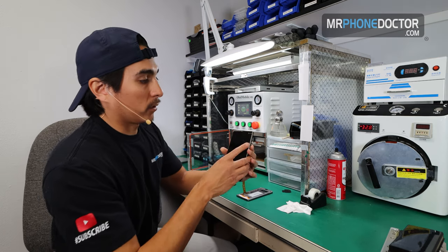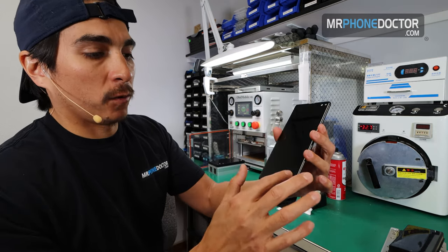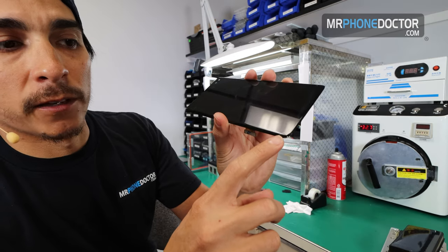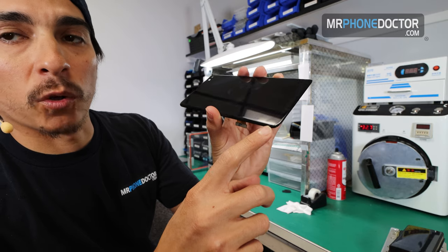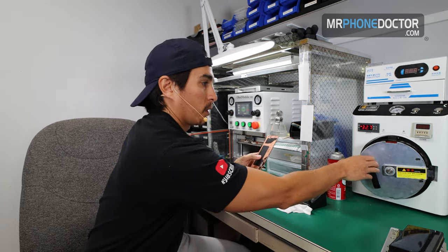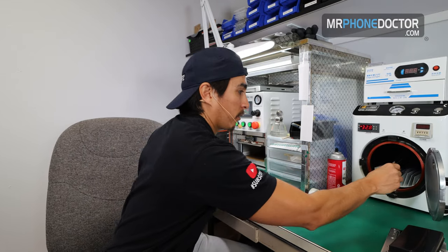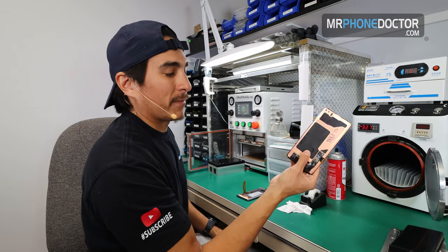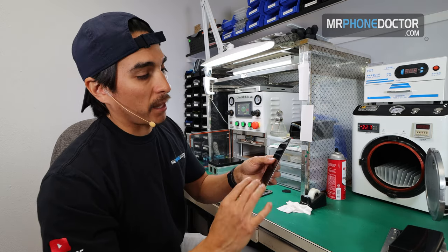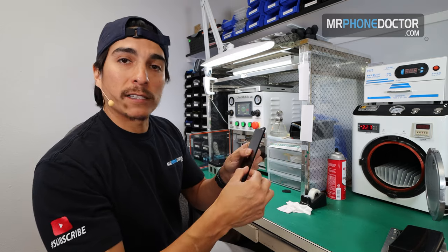So our last final two steps is of course going to be to autoclave. Autoclaving is gonna relieve any of these little minute bubbles that are there. And you can see it still shows that little clip that was there from the polarizer. So you know this is the same OLED we were working with. So I'm gonna go in and set this in the autoclave for about the same amount of time, 13 minutes.